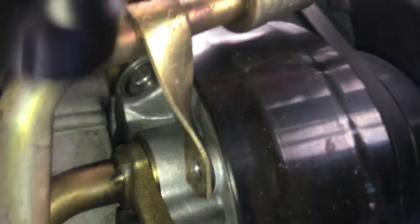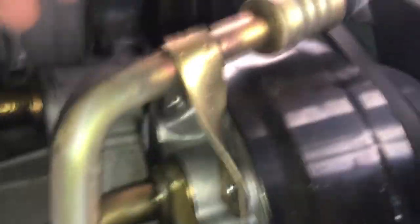I have my black light and I'm looking around at the case. This has been changed before — it already leaked. These are the new-style O-rings, but actually these are not O-rings, this is the bushing. This is the new machined case, not the old casting. It's missing this bolt right here, and it used to have an O-ring down here. This has already been replaced, so I'm probably not going to have a leak right there.